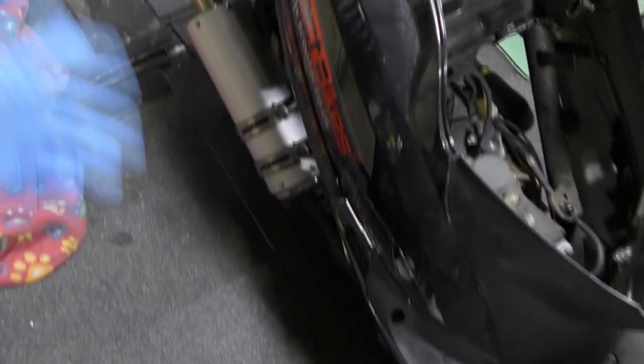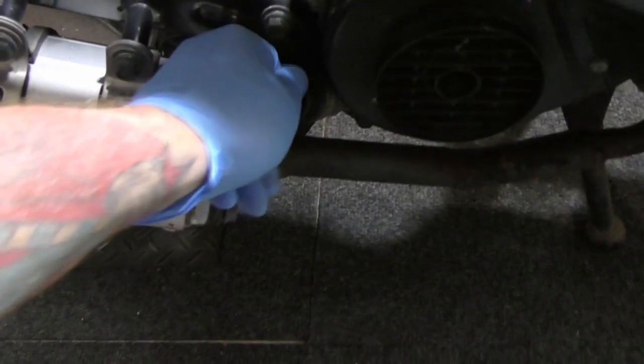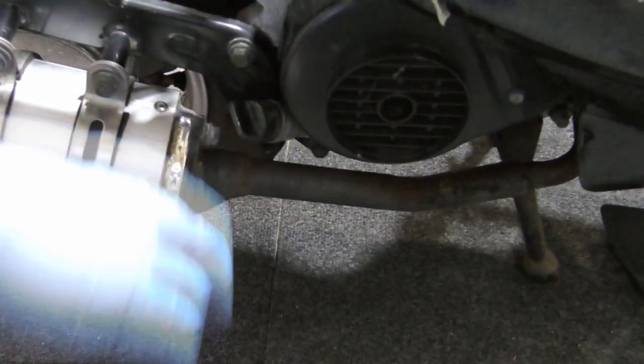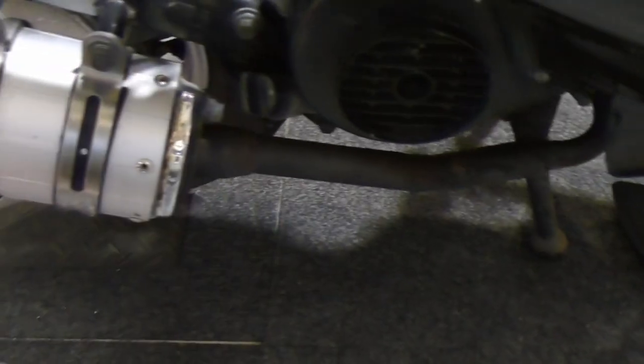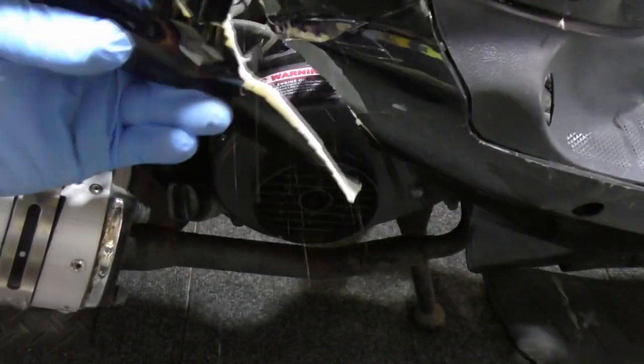I want to get all this lot off and bond it. Also, oil change. The oil is here, and there'll be a little bolt under there — 13mm or whatever it is — and we're going to drain the oil out and put some fresh oil in. But first I want to see, will it start? So I'm going to change the oil no matter what. Get this old oil out of here. Poor little lad, that's just terrible.